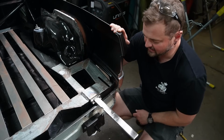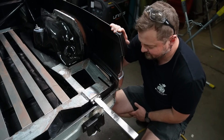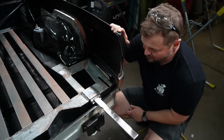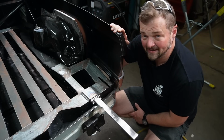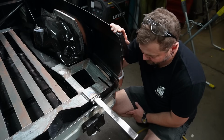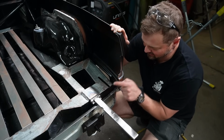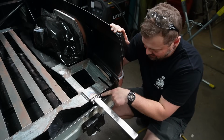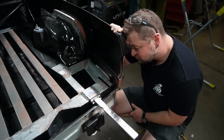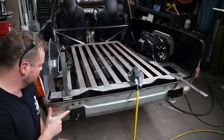We've welded this plate in, but I only ever tacked the two outer barrels to the plate, which isn't very strong. And it means I never got any welds underneath, and I'm gonna need to put more welds on the top. And I don't know what I'm gonna do about that. Because I can't weld underneath while it's in there, unless I can grind the paint off and maybe weld it to the frame, which might be strong enough, but dang it.